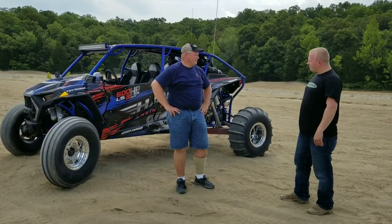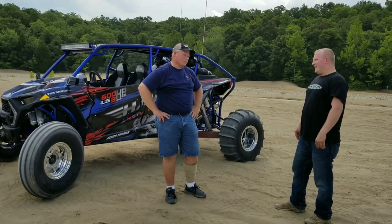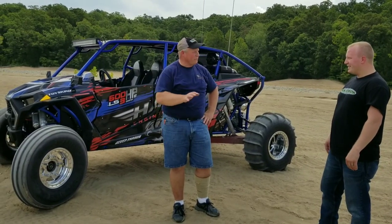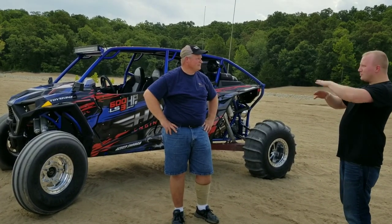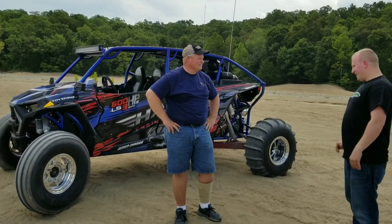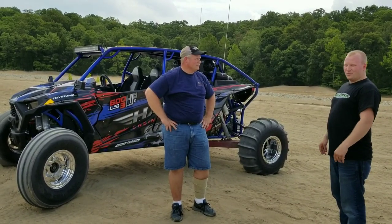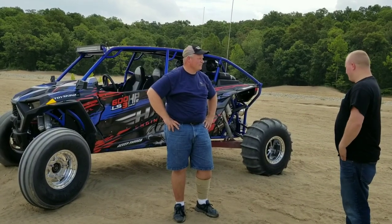We're back. Pretty good — what do you think? I'm pretty happy with it. I'm trying to work on the suspension a little bit; I don't think it's squatting enough to hook up. We dropped the pressure from 11.5 to 8 and we're getting close, but there are little things to dial in. When you dropped it down it almost just wanted to light it up — yeah, not a lack of power, just a traction issue. This sand isn't really ideal, so it's all power. I think with a little more grip — like when you go somewhere like Glamis — you're going to have a great experience.